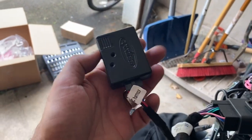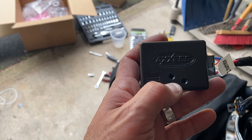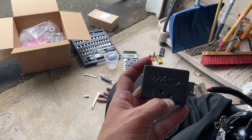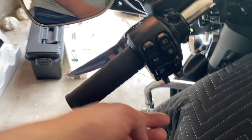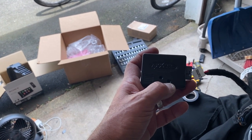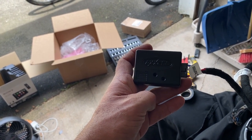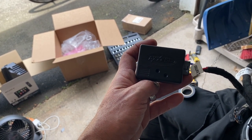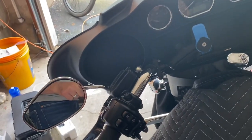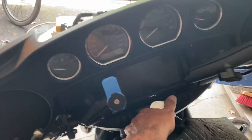Took the plastic off and there are two holes: one is the blinking light you'll see once you turn it on, and one is clickable - a small screwdriver goes in and you press it for three seconds. Once it starts blinking green-red-green-red fast, start clicking up the joystick. Each click, make sure it's still blinking. The minute you see the light turn to steady green blinking, stop clicking and wait. It'll go through green blinks, then switch to red blinks, then solid red - at that point your hand controls are synced.